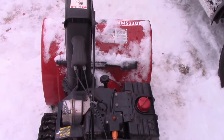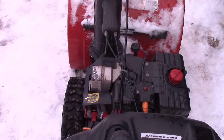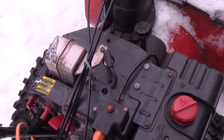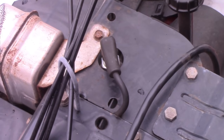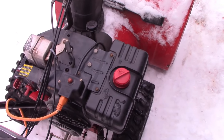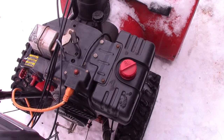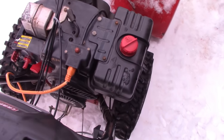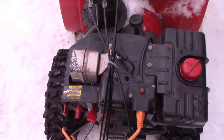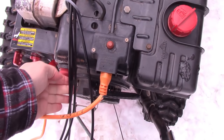First time I've ever owned a snowblower — this is a new experience. Of course it came with no instructions; I've watched some stuff on YouTube to figure it out. The game plan is: I'm going to change the spark plug first. I've already added something called dry gas to the gas because it's old, and I even added a little extra new gas to mix it in. But I might have to completely drain it. I've been trying to avoid it, and I'll also dump the oil today.